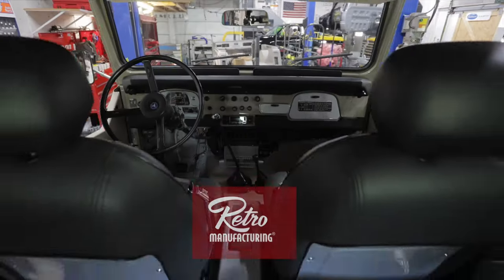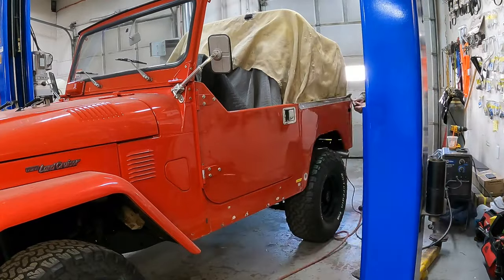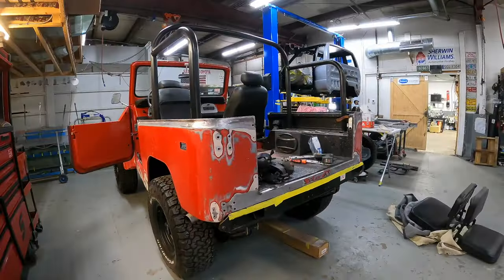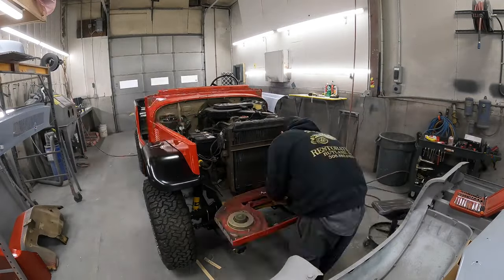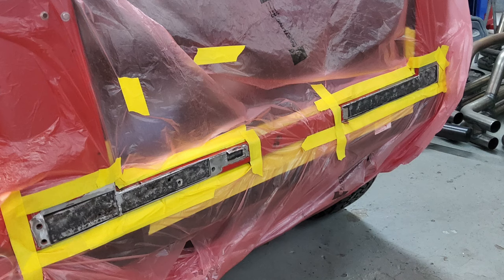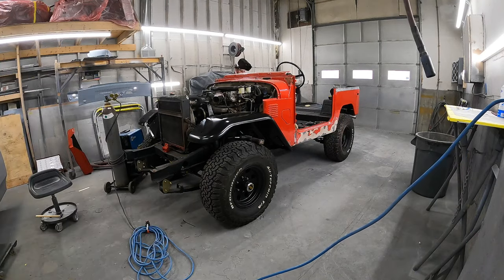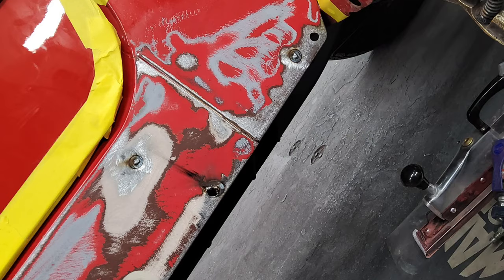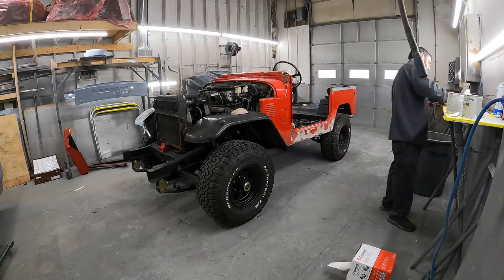The biggest part of this project was restoring the body. The body had a lot of hidden things from previous owners. Sometimes when you get into restoring vehicles, you can't see these things until you tear into them and take the three layers of paint off. This vehicle was stripped down to bare steel. It wasn't really a rot box — it had a little rust in common spots in the rear, right below the rear half doors, and the rear channel was rusted. We repaired that and put new metal in. We also had to remove the old diamond plate from the 80s and 90s, weld up a bunch of holes drilled everywhere from old CB whip antennas and accessories. There were some dings and dents we fixed properly, and the driver's side rear quarter panel had been in an accident, so we straightened that.